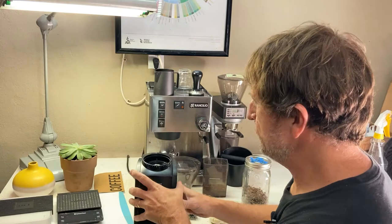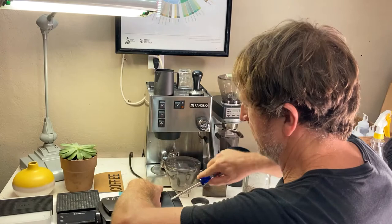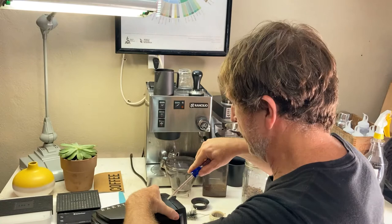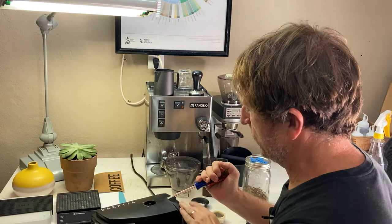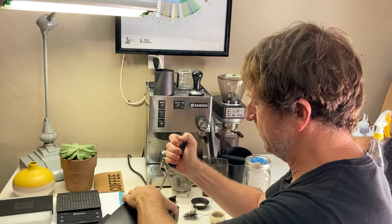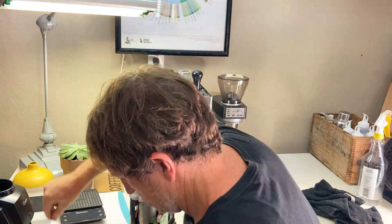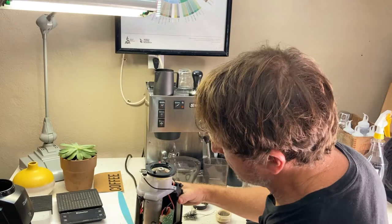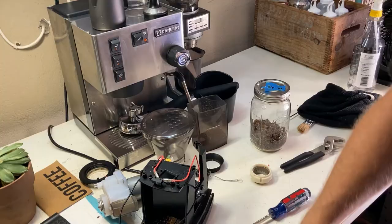Now that I've got the wing nut off the top, I'm going to remove the button from the side — you can just kind of pull it out, it's not hard at all, it just comes right off. Next step is to take your flathead screwdriver. This part made me really nervous the first time because I thought I was going to break the plastic on my brand new machine. You just kind of shim it in there a little bit and then push away from the body, do it on both sides, about midway through, and just kind of pop it forward. The body just loosens up. That piece that fell is actually the piece that goes to the back — just goes to show you anytime you're doing a repair, you can have surprises.